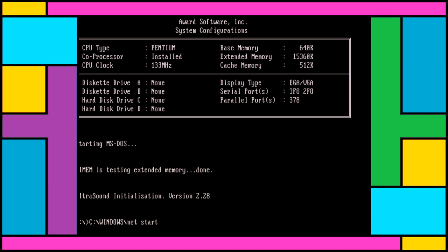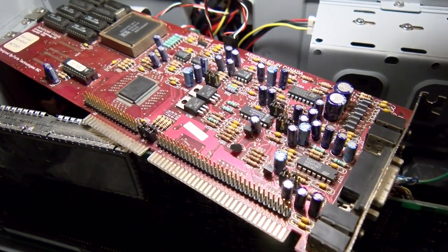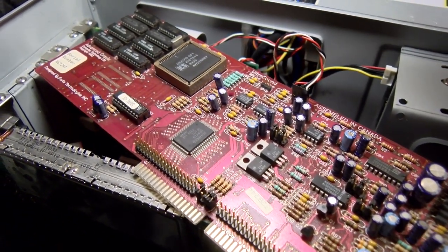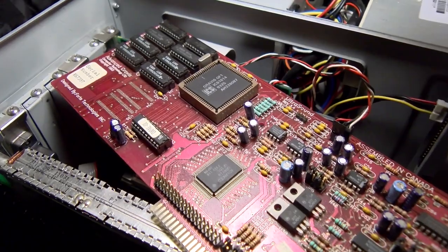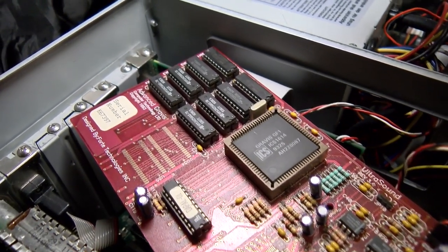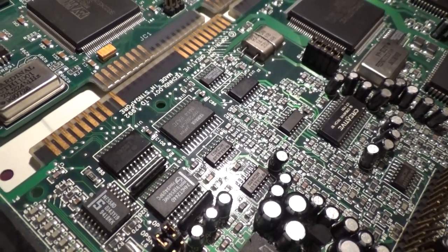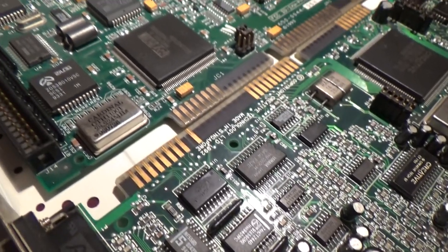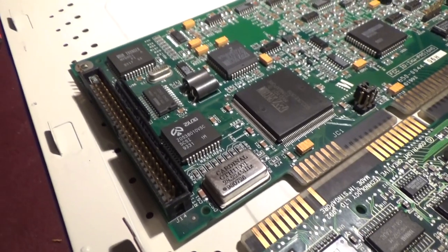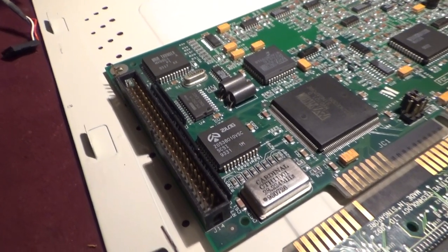The other option, SBOS, is a total mess. For one thing, the card has no FM chip, so it has to emulate one using samples, which never ends well. To be honest, I don't think there's any conceivable excuse for this on an ISA sound card, short of studio cards that explicitly stated they weren't for running games and made no attempt at compatibility at all. But even then, MediaVision had OPL3 and Soundblaster compatibility on their studio card at this time, and it's not like FM chips were particularly expensive anymore.